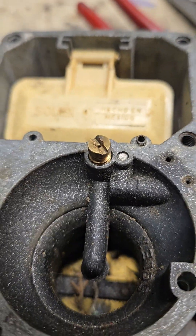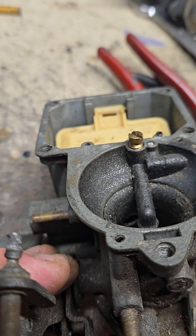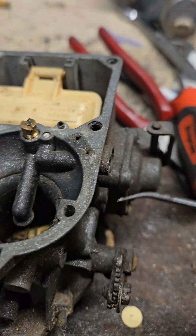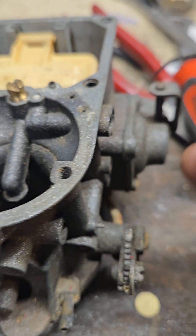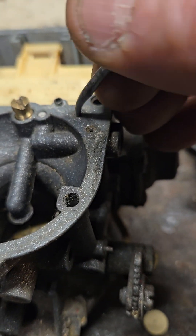As I showed on the car, when you crack the throttle the nozzle squirts, then as soon as you stop moving it, it stops squirting, and the engine wants to die because there's not enough fuel coming through the idle circuit. So if you put about a 70 or 75 pilot jet in this, and also make this hole two millimeters, that'll probably fix your flat spot.